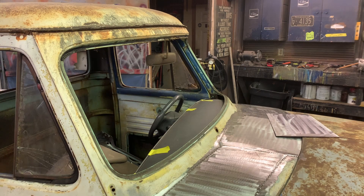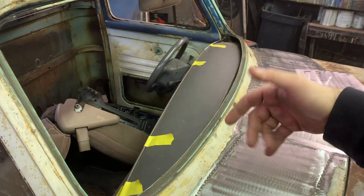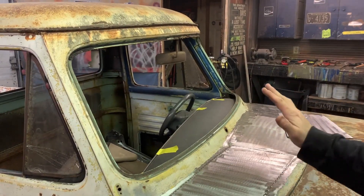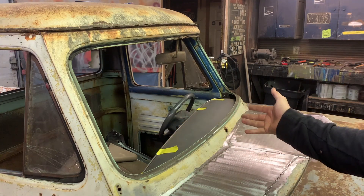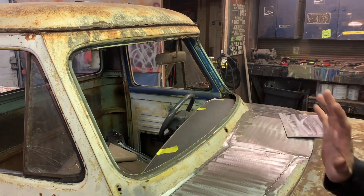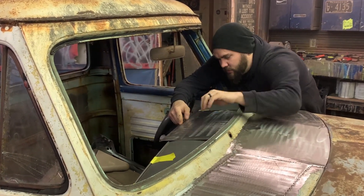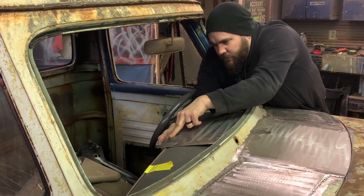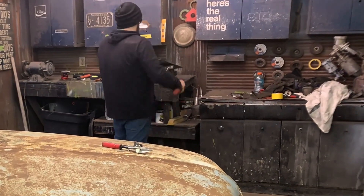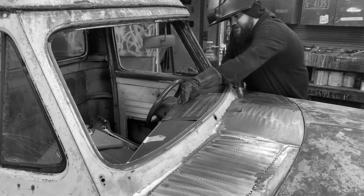I got the round bar put at the front edge. As you can see I got some tape holding it there, but it's actually welded in on both sides — the bar is kind of flexible so I don't want it to come loose. Now you can also run other round bars out to it to hold it steady, but in reality I don't need any of that strength there because I'm going to be putting sheet metal over it. I'm just going to put the sheet straight on. Also, when you're welding on top of a plastic dash, it's fun to watch how much stuff catches on fire — so we're going to be real careful.